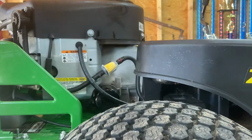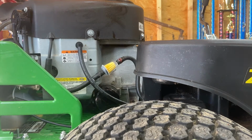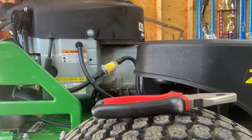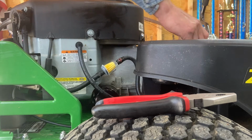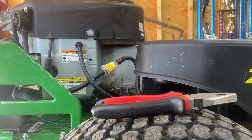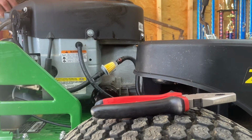We'll pop this air filter out and put the new air filter in, and that's basically the first part of the maintenance. Once we top the engine oil off and change this air filter out, we've pretty much done a full service. The transmission on this ZeroTurn is all self-sealed, and it's a non-maintenance item, so it's maintenance free in theory, as long as nothing tears up, and you don't have to do anything to the transmission on it. It's a sealed unit, maintenance free.